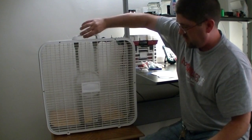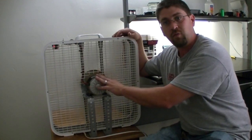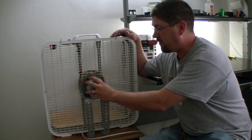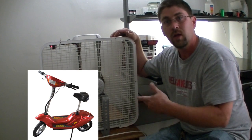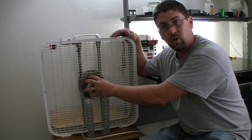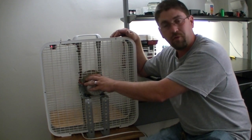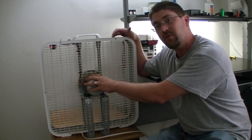The second thing you're going to need is a DC motor. You can find them usually a dime a dozen, especially from kids that don't like their electric scooters anymore. This one came off a little electric scooter, and a lot of them use this exact same motor. It is a 24-volt, 350-watt motor that we're running at 12 volts. And believe it or not, even at 12 volts, it's more powerful than the original AC motor — I can actually spin this fan faster than it was stock.